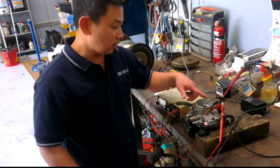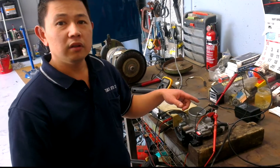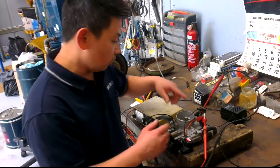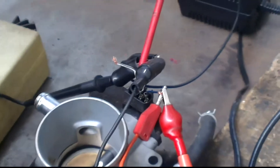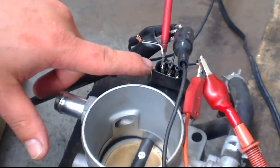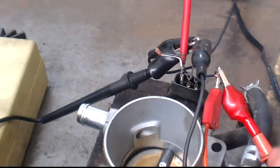Going through a transformer and a digital multimeter. At the present moment I've got my transformer supplying 5 volts. The TPS sensor usually operates between half a volt to maximum 5 volt. So if you look down here, you can see this pin is connected to my signal wire. The middle pin is my negative or ground. The last pin to the right is actually the power supply through the computer.